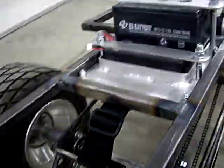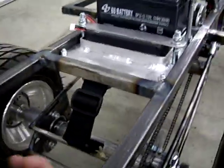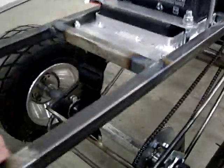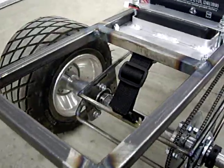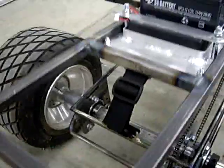And we made a change to the back of the vehicle here. We've got a limiter strap. I think that's just a general good idea. It means we're so far sprung up at the front that in the event of a tumble or anything like that, I don't want the suspension to rip the vehicle apart. And, you know, they do this on regular race trucks. And I think that's going to help considerably.